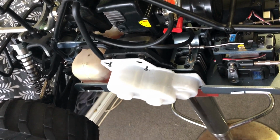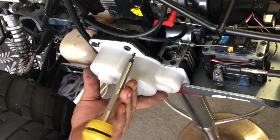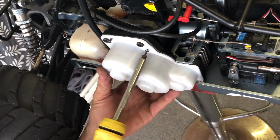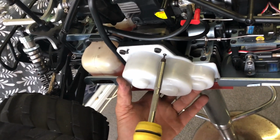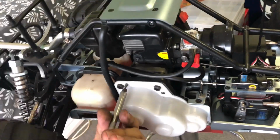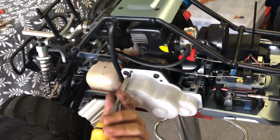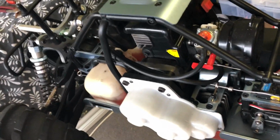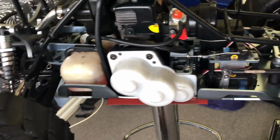Okay. Yeah, so I don't know how this is going to go. I don't know what the RPM range on that spring is, so we will very shortly find out. Same with these little screws here. Don't overdo them either because they're plastic, and I think these are on the verge of actually stripping out myself, personally. You've got fine threaded screws going into plastic, which is never really ideal. The bloody things, they don't last forever. So yeah, just go careful.